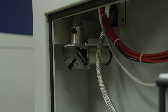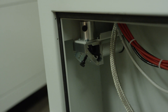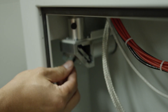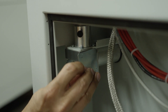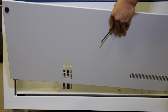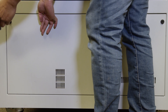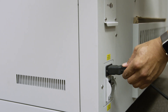Remove the magnetic cover from the front of the mirror housing at the bottom of the periscope. Loosen the black screw on the bottom of the mirror housing. Re-install the panel on the back left corner of the machine. Re-install the two panels on the left side of the machine by using a 5/32 inch hex key to turn the black panel locks three-quarters of the way clockwise. Then plug the machine in and turn it on.